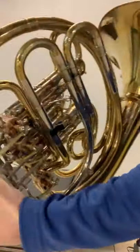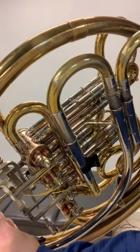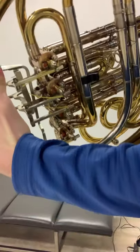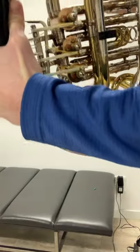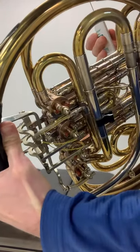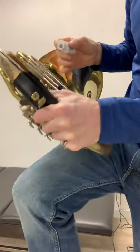The other place where we can put oil is on the bearing — these little cracks here. Do you see where the arm is moving the rotor? There is a crack right there, and we just put a couple drops of oil there. Just a couple drops, wiggle it, and you're good. Now my valves are quiet.